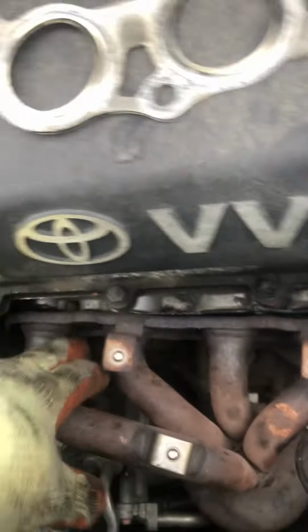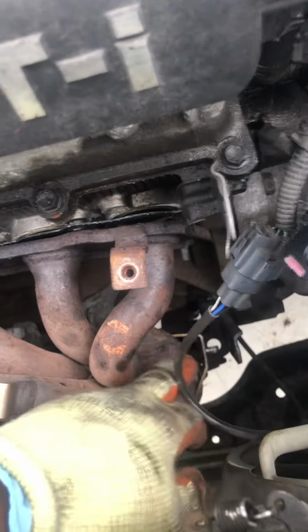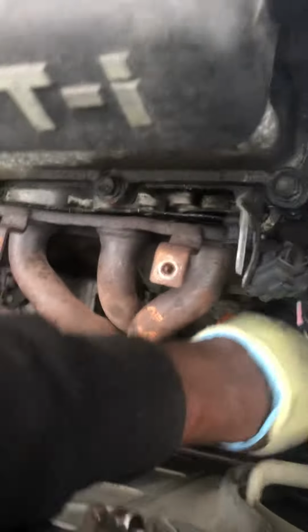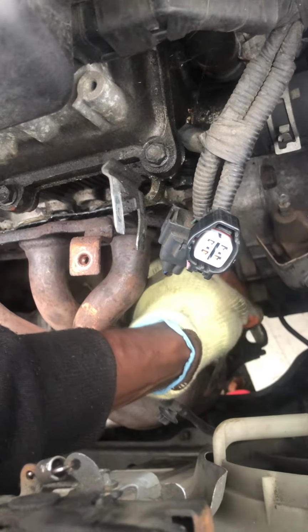Okay, so after you've taken these 2 screws out, go upstairs, and thereafter remove all the screws now. The exhaust mount screws, remove all of them now, completely remove them. And the side screw, the side screw has a metal bracket. Unfortunately, you have to make the other screw loose for it to move sideways.